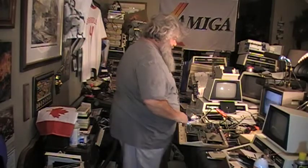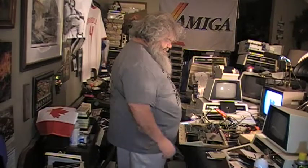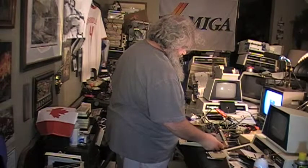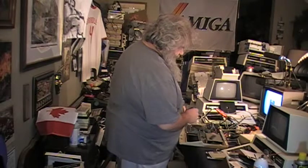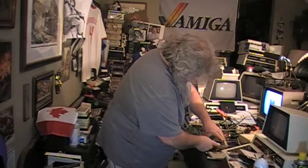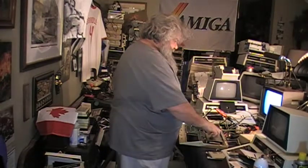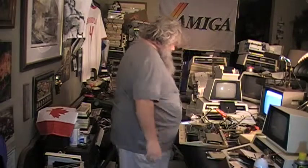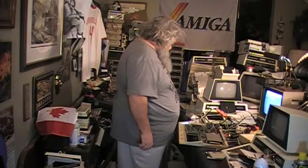And it is in. And now I'm going to apply power. And if the 68,000 chip is in fact the issue, then one would think that it would not come up and request having such a hard time getting this disc. There we go. I'm thinking if it was the 68,000 chip, then it would not fire up. And it certainly wouldn't ask for WorkBench. So, we'll just see. Okay, battery backup clock, not found. Good, fine, dandy.